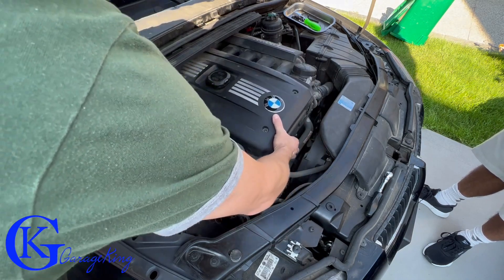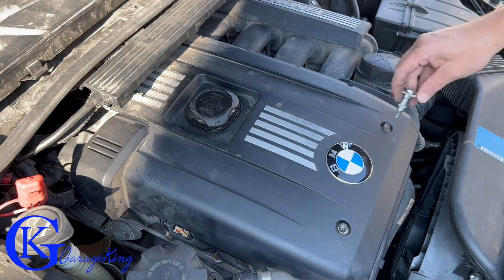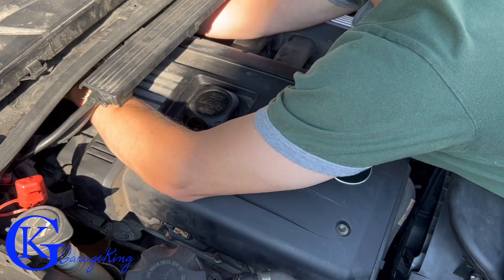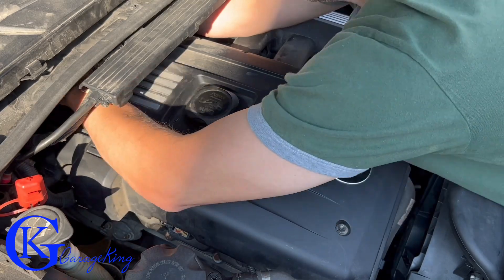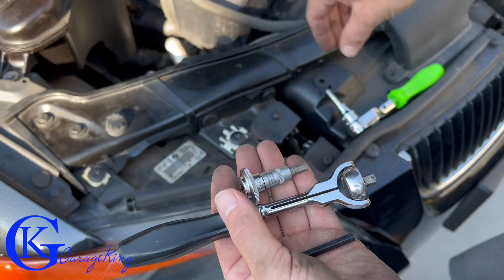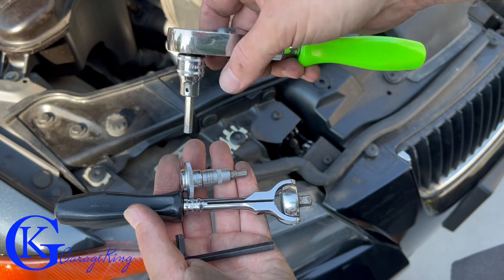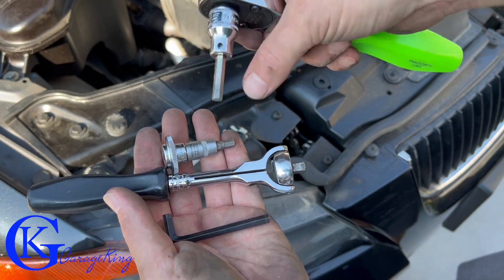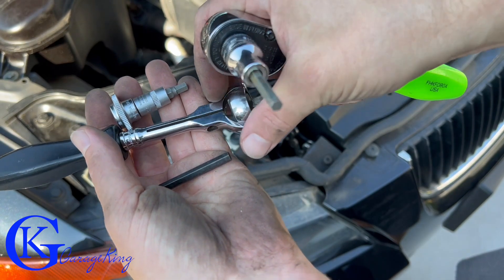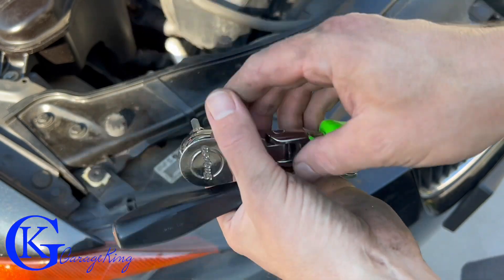Once done, arrange the plastic cover, line up the holes, and put the bolts in. I don't snug them all the way at first — just loose by hand — to allow for last-minute adjustments. Once all bolts are in and nothing is cross-threaded, torque them down. After doing this, I ran the car and the check engine light came back, but for the other cylinder. That told me it was definitely a bad coil. With just these few simple tools I was able to diagnose this E90 coil in a few hours on a Saturday and save some money. Leave any questions in the comments — see you next week!